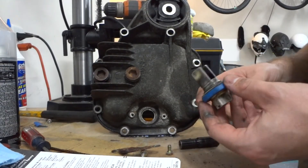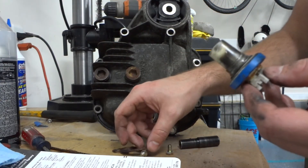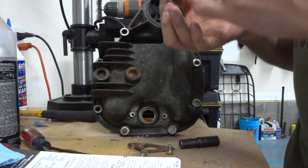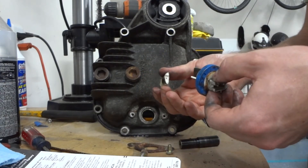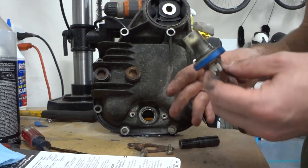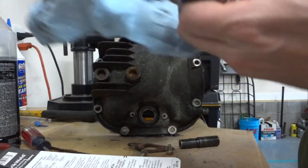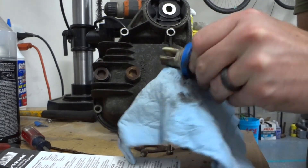This is the gift that keeps on giving. This right here is the vehicle speed sensor, which probably gives signal to the speedometer and potentially the transmission or stability control. What we have here is a broken sensor. I'm wondering if that broke when I initially took the cover off — if it went sideways a little bit, it may have caught the gear set in there and just broke that off. Regardless, this is a special-order item through local parts dealers. I did find it on Turner Motorsports — the genuine BMW one is about $50. Another option is the salvage yard.